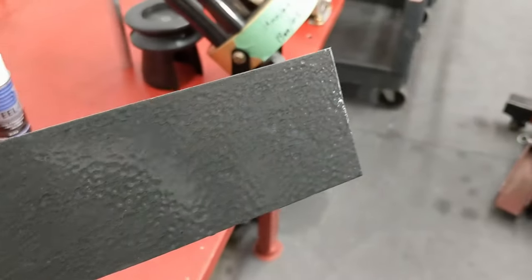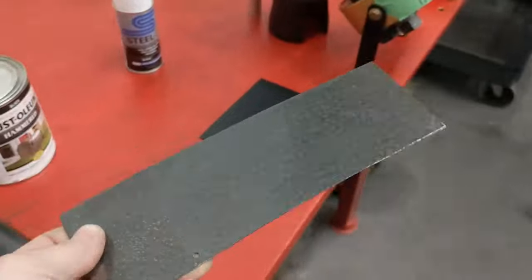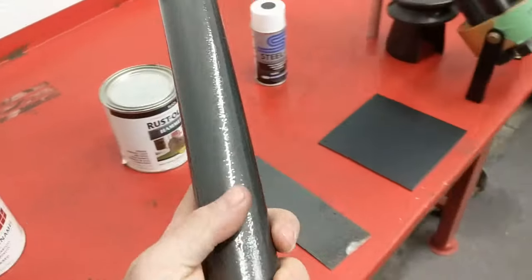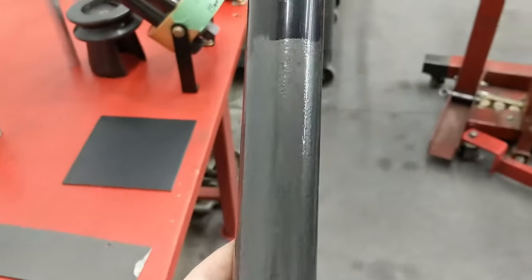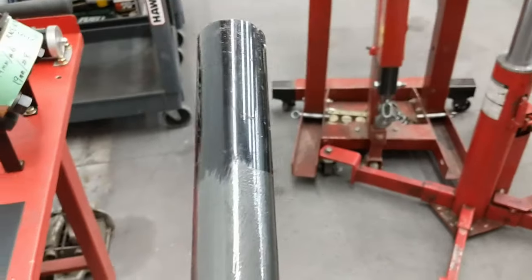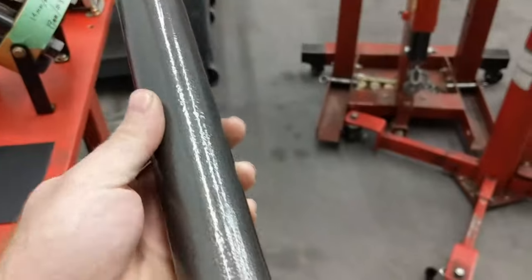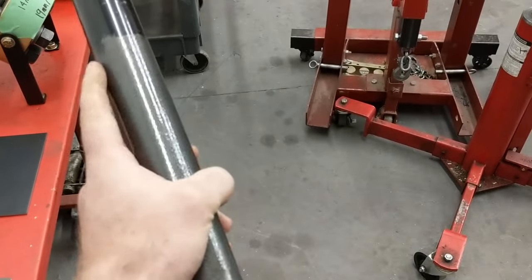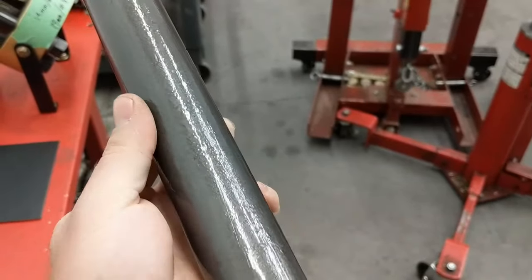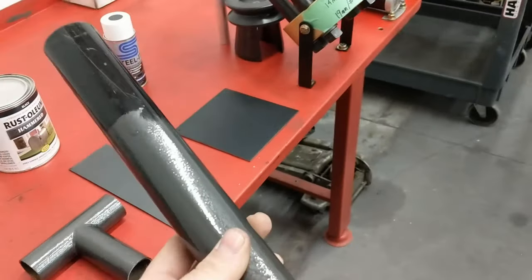You can see how it looks on a flat panel - really decent. If you don't like the hammer tone look you won't like it, but if you're going for a hammer tone look this is by far the best product. I also have a roll cage with paint on certain bars already, and I did a test where I sanded half the bar down to bare metal. I couldn't tell where I'd sanded through - it's so thick it covered it right up. This was my go-to product for my 25-3 cage up until recently.